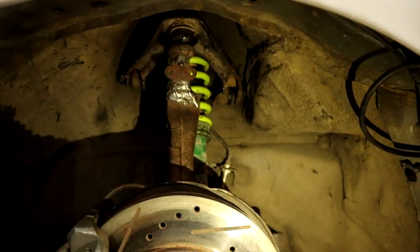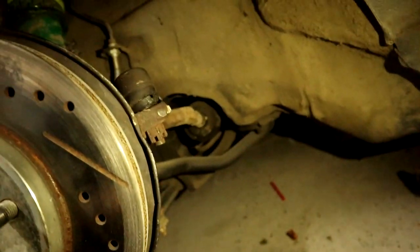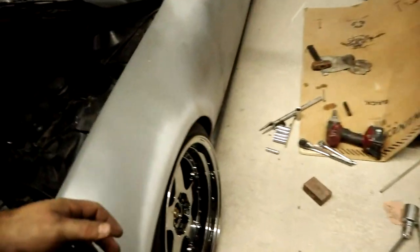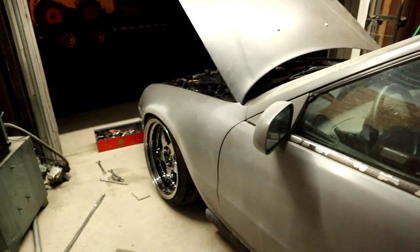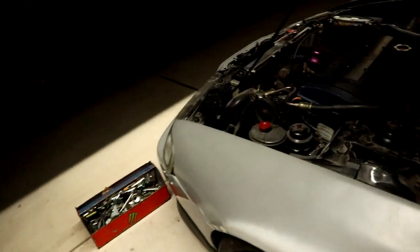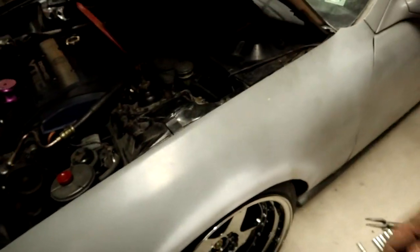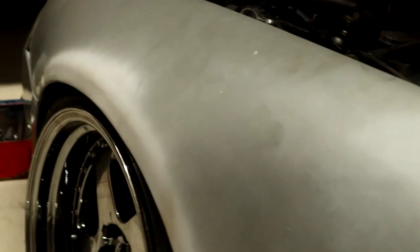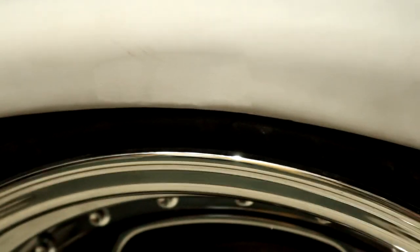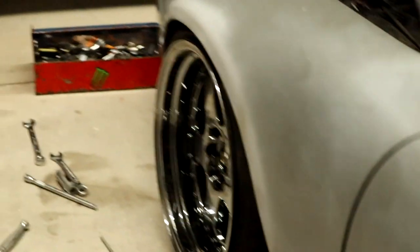I have to make them again right now. Let's put the wheel on — that's gonna be the final test fit, except it's not a test fit anymore because it's gonna fit. Fingers crossed. Aside from adjusting the toe, this side is good. I'm gonna raise it up a little bit — it'll take away some camber when I raise it, so it'll sit like it was before. Doing all this definitely lowered it — you can see the fitment.